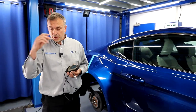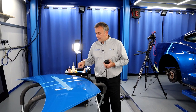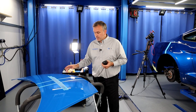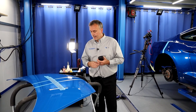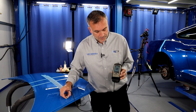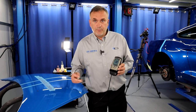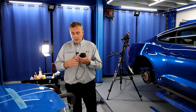I'm going to take you over to a training panel. This training panel is purposely painted by us in-house, and we've got eight of these exactly the same. It does replicate factory paints. We've taken it back to bare metal, put an etch primer on there, then a high-build primer sanded down between coats, then a base colour — a gloss blue — and a clear coat lacquer. You can see that is very typical of this vehicle here. We've got exactly the same thickness of paint material, the total volume of paint material.